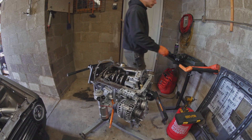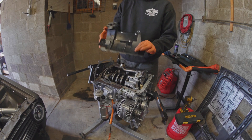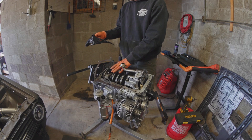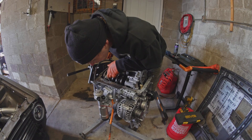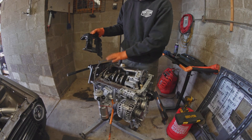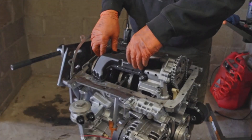That was kind of a pain in the butt, as I knew it would be, because I used gasket glue as the way I put the oil pan on, which is about as good as you can put a pan on. At any rate, this is the part I bought that I was missing. I have a feeling someone was in here before me because there were factory things that weren't factory anymore — this is one of them. This is the windage tray, which basically collects oil flung off the crank and drops it back into the pan. It also connects to the set of holes which I think are the oil return from the head, and it also keeps some of the oil from splashing up into the crankshaft area. Additionally, you may find when you put your oil pump on that the back bolt is too long — that's because you're missing the windage tray.